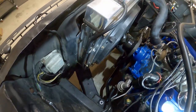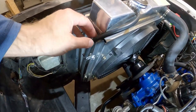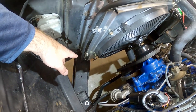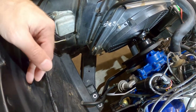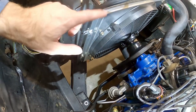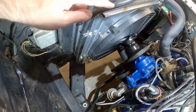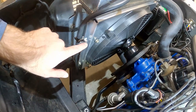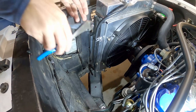All right, where we're gonna put this on my car is just right next to the radiator here, where I've got that overflow coolant hose just running down the side, and it's just designed to drain out the bottom if I ever have any overflow. But really, we wanna have a tank on here, and some people put it on the fender wall here. I'm going to utilize these mounting points that are part of the setup here because the tabs are lined up with that. Then we're just going to mount on the side, and then we'll just hook this tube up to the bottom. It's a real simple install. Anybody can do this. All I need is just the tools for that, and then we'll put it on. So let's go ahead and get started on it.